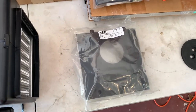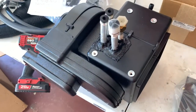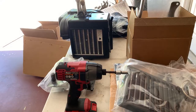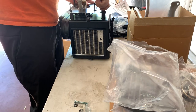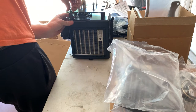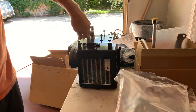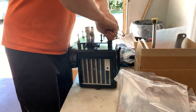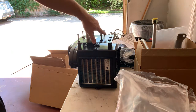The next thing we're going to do is attach the mounting bracket to the entire assembly. Get out this package and open it up. It says to install the bracket to the unit using four quarter-inch by two-inch bolts and flat washers, which are conveniently located inside the bag. Now, notice I did it only hand-tight — I did not use power tools. I'm just going to get a socket and snug these up. This looks like 3D printed material or very thin plastic, which doesn't need to be super strong — you just hang it in the dash. I would not recommend using power tools on this. Even though the stud receivers are metal, everything else is plastic and you don't want to crack it. This is very expensive.